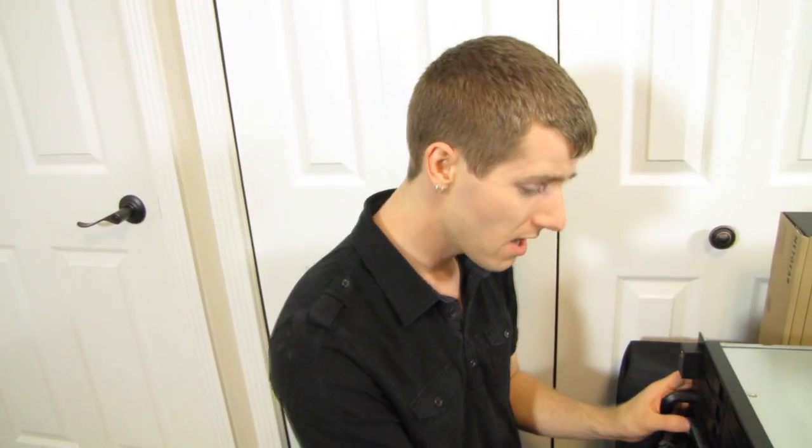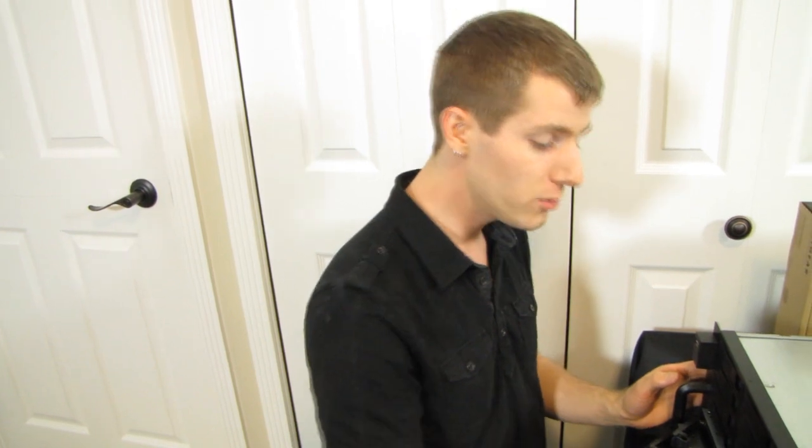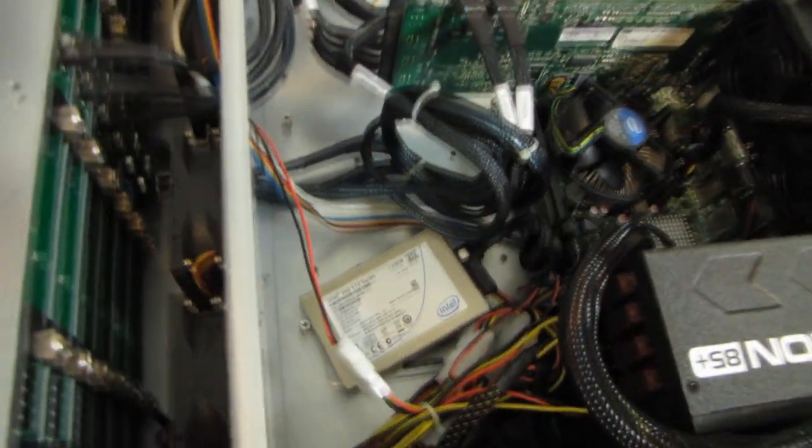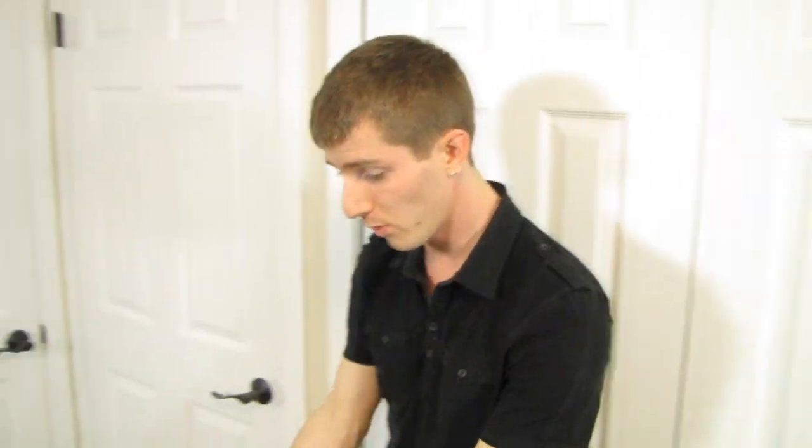So what I want to do is build a proper setup for Windows Home Server 2, which doesn't include the drive extender. So I can no longer use my random mishmash of drives to get my eight or nine terabytes of storage spread over 16 drives — I have to build a proper RAID array. I'm going to get a new boot drive, since you need at least a 160GB boot drive for Windows Home Server 2, so I can't even use my 120GB Intel SSD. I still want to go with an SSD — I've had far more hard drives fail over the last few years than SSDs.